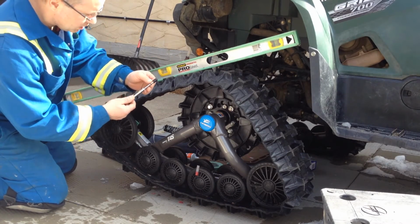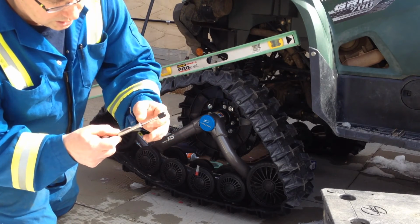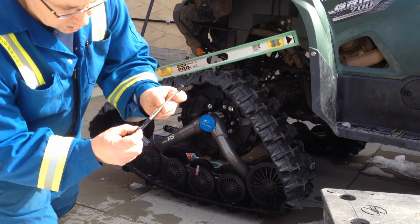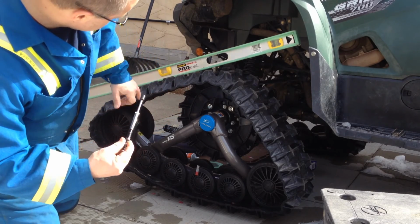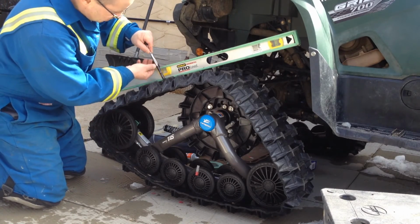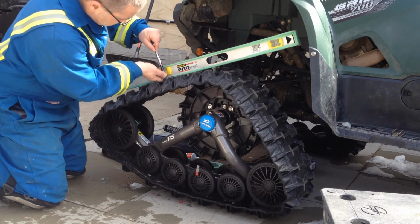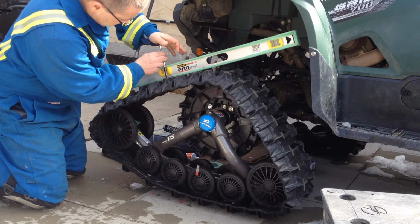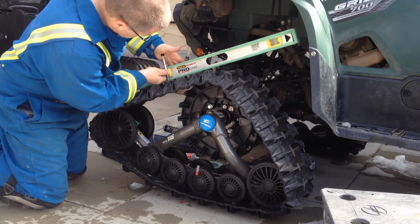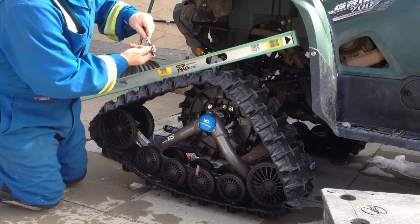You're going to bring, hopefully you guys can see this, your rubber gauge, this guy up to here. And this part here, you're going to measure at the bottom. This is all new to me too, so we're working it. Measure it back to here. You want to see your deflection. Go down, I'm going to push. And we're at 30 pounds, which is 3/4 of an inch.